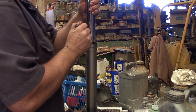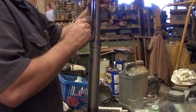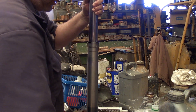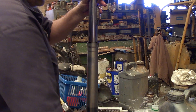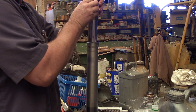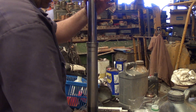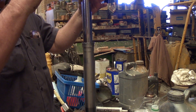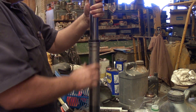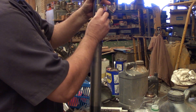You want to be sure that your snap ring is bottomed in its groove, because this is the only thing that holds your fork tubes together. So if you put this together and leave that snap ring or curl clip out, you might go over a big jump or hit a big bump and your fork slides right out of the tubes - that would ruin your gear real quick.